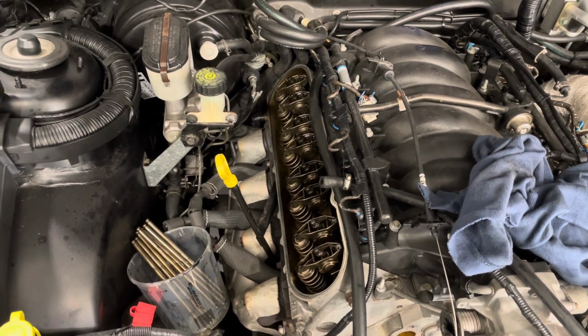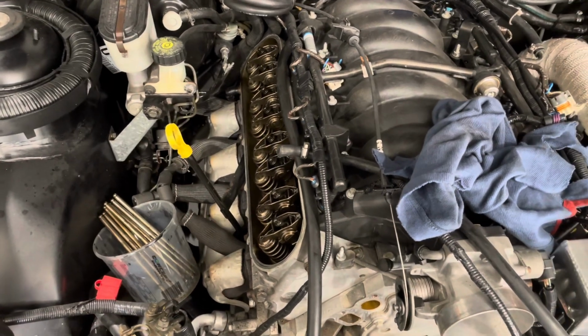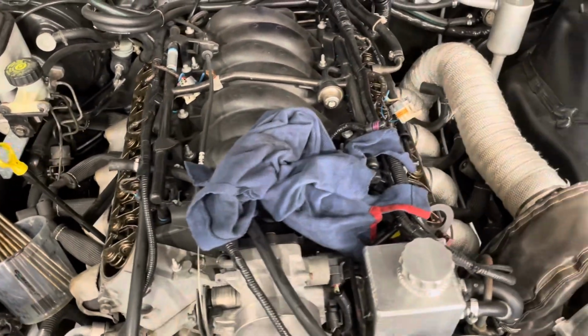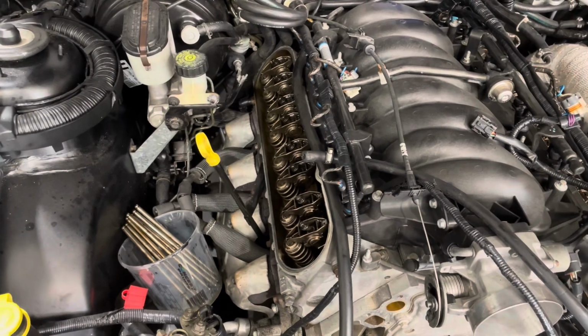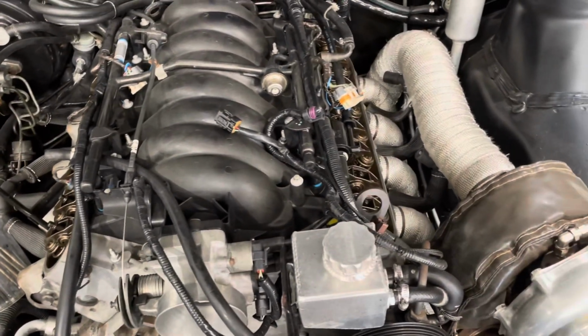I think they're 516s or something like that they're called. But yeah, more than enough for the little cam that I'm going to put in there. Another option is also trunnion upgrades. They recommend that for anything up close to 600 thou. The cam I'm putting in there is not up that high. It's only a little cam, so standard trunnions should be alright.